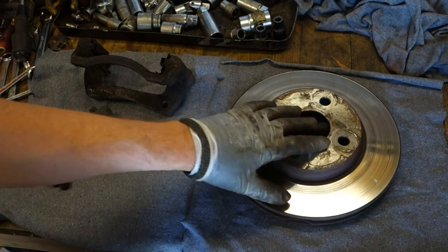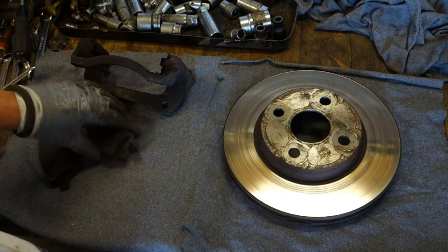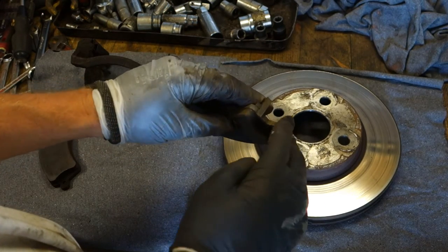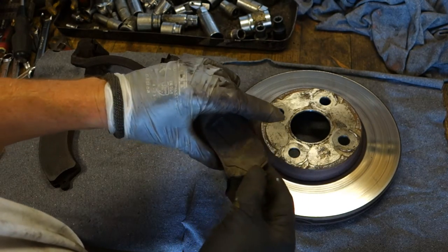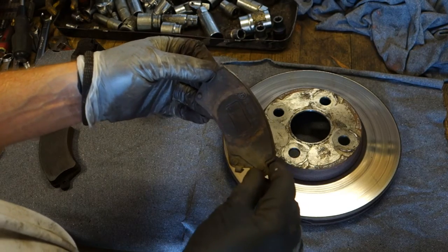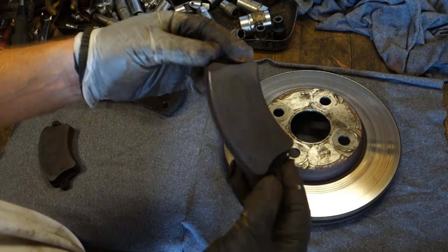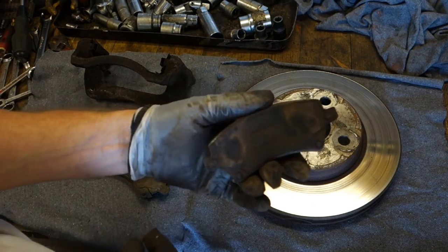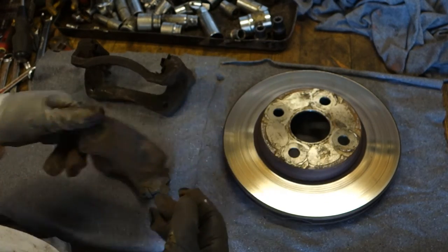Okay, and then when we are inspecting these parts, it is first important to inspect these pads. And in this pad area, there should be grease. And there is no grease in these pads. And if there is no grease, this specific grease, then these pads create bad noise, this squealing and scratching sound. And this is the same on this other side.